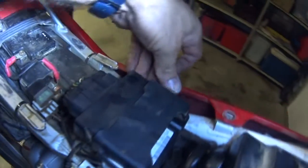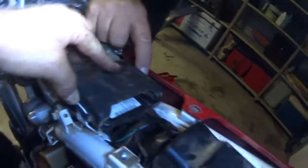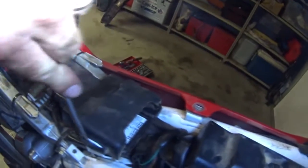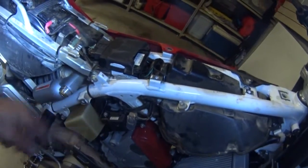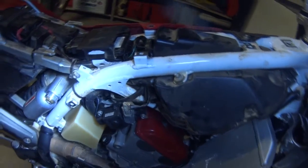Start on one side first — tuck it in and then just stretch the rubbers. Get the flat blade screwdriver when you have a free hand and tease the rubbers over and poke them down on the clips. Now, some bikes' first couple of starts are a little bit rough. I find it's probably better to push the start button just momentarily and let the motor park — do its electronic noise that you always hear when you switch off. If you do that a couple of times it should settle and start okay.